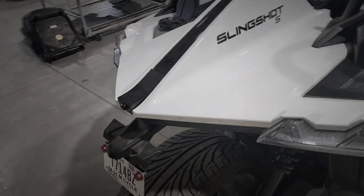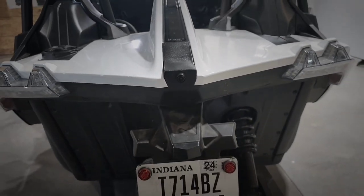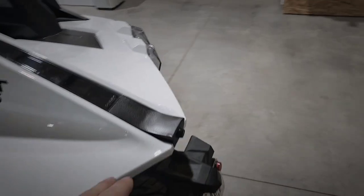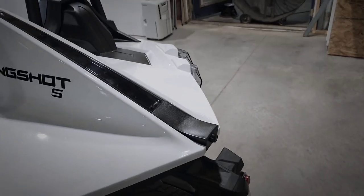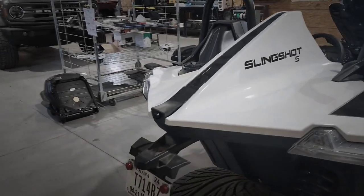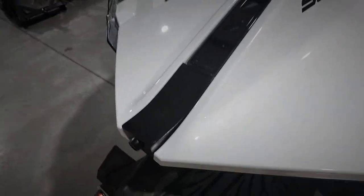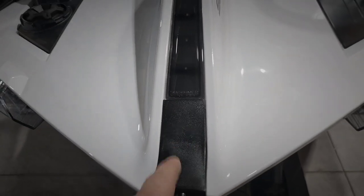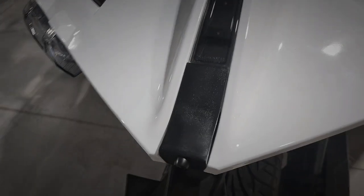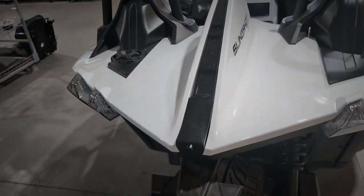As an added bonus, because I did not like the way the license plate camera was going to look, I went ahead and built a backup camera mount like the factory ones would have come with. But there's no option for a 2021, so I took the factory plastic piece, took some low-heat plastic, molded it in, put on some sides, did a little body filler, sprayed it black and cleared it over. Now his camera is right there on the back — way better than being down there. If you try to put the camera where it bends down and comes straight out, it doesn't work because you pick up those side fins and they take up half the camera. You have to bring the camera out to the edge.